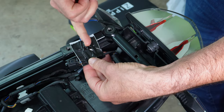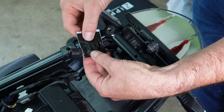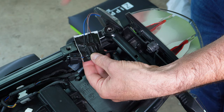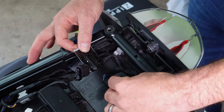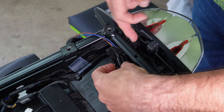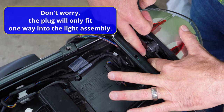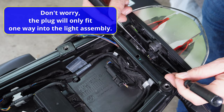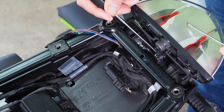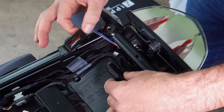It may not look pretty, but it's more than enough — those connectors won't pull out of the cables no matter how hard you try. This is just to hold everything firmly and stop it moving around. Fold it gently over, place it back under the top bar, reconnect it into the tail light, and use your two screwdrivers to push it firmly into place. Listen for a click — that tab has just clicked back to the right.